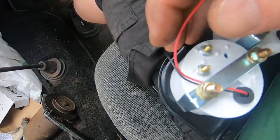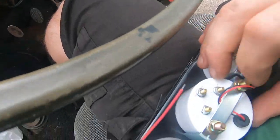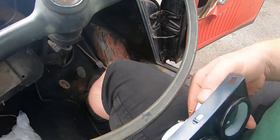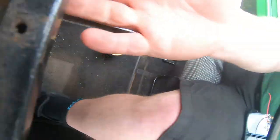Looking at wiring - positive and negative which is just to give you battery reading. This one here has positive, negative, and a signal - that is the temperature gauge, so the signal wire is the only one we need. Again, positive and negative - we can just bridge these. And the same with the oil pressure. So we've only really got to run two wires into the car and the battery feed. That's going to be pretty simple. I'm going to go and find some wire, get some ring terminals on there. There's a screw hole there that I'm going to try and use for now, just to hold it up while we do all the wiring.